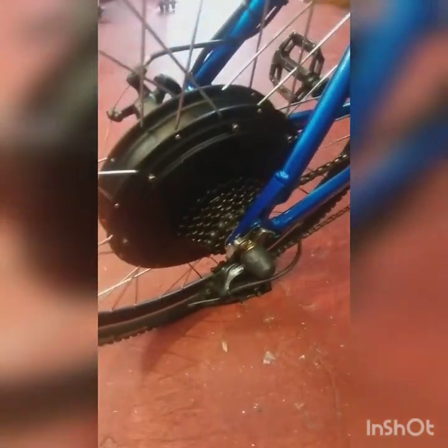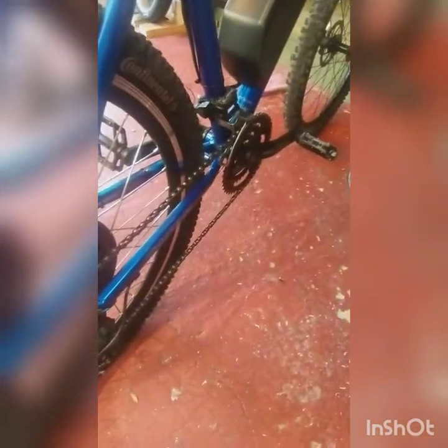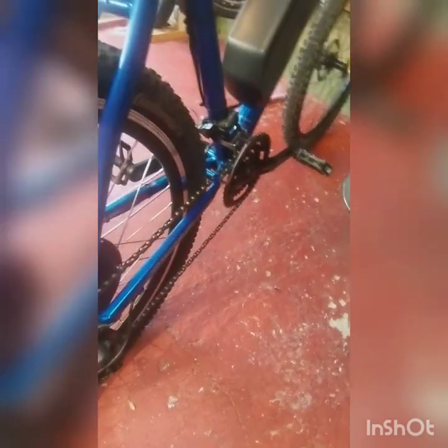The build's finished. I've got the front wheel painted black just to match up a bit better, and I've done the derailleur — adjusted the two limit screws which stop it coming too far either way. We've got the top six gears working and there are only a couple on the front — 12 gears in all — but pretty much I think it'll just be left in top gear.